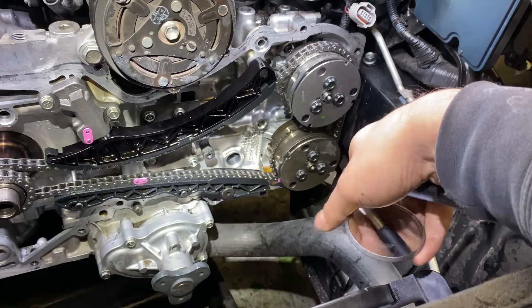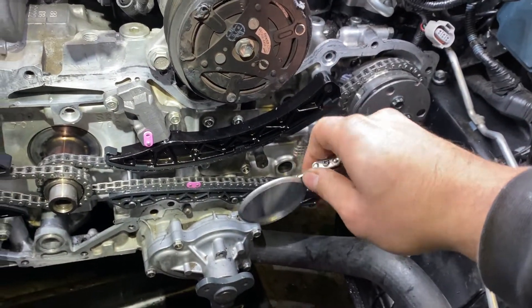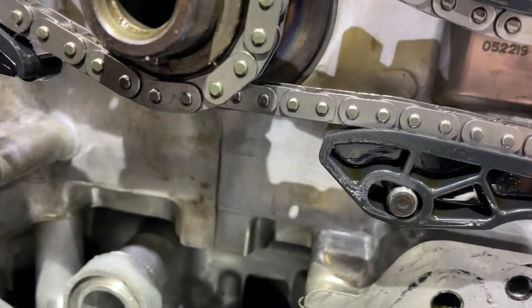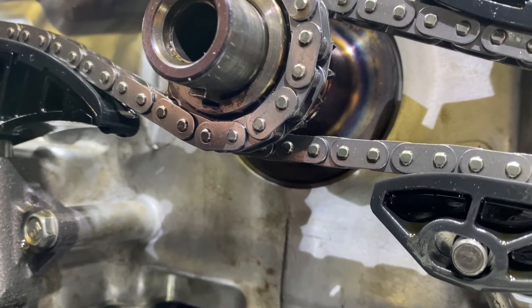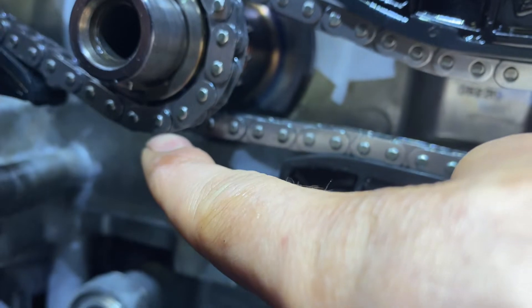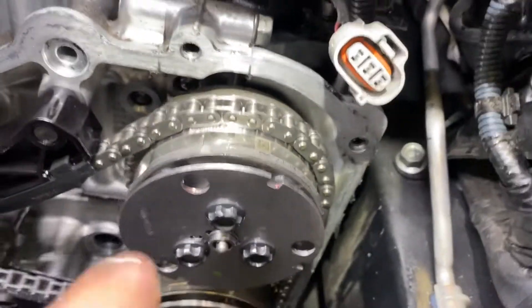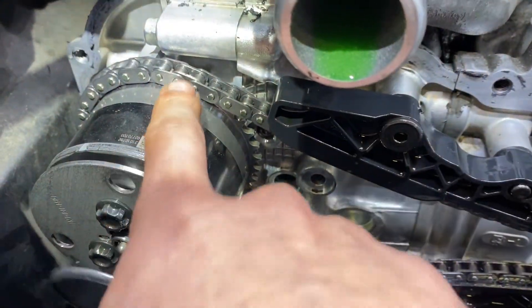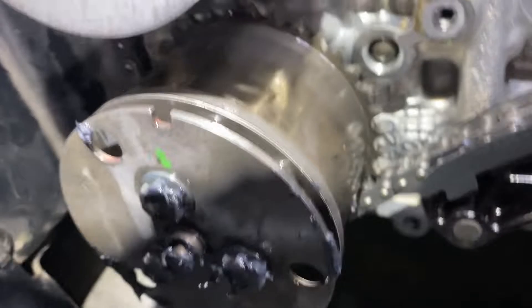A lot of videos point out it's similar to a timing belt on dual-cam Subarus — same concept. The crank lines up underneath here. Once you do your marks, they're both going to line up on the front and back timing chain equally. You have your arrows, and on top the chain will line up with the arrow — there's a line on the side it lines up with. Same thing on this side. You can see the pink marks on the chain; those line up with the marks on the sprockets. Then you have your two timing marks — just make sure they're lined up evenly.